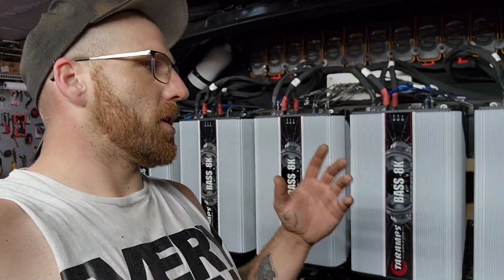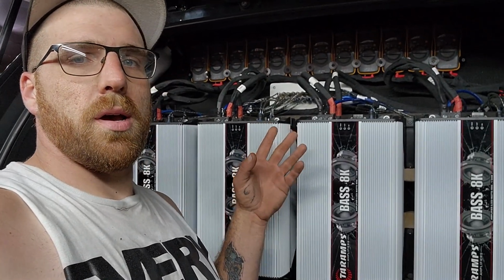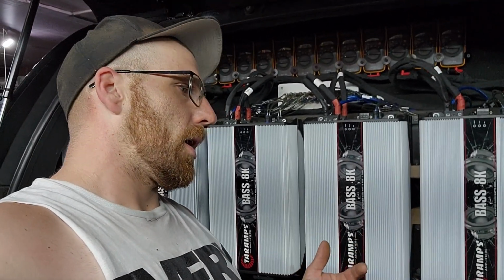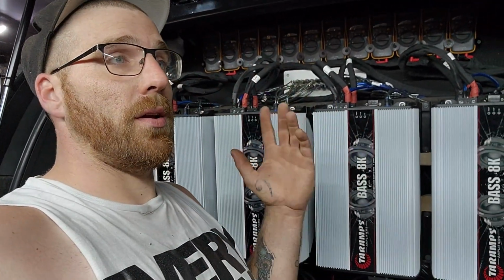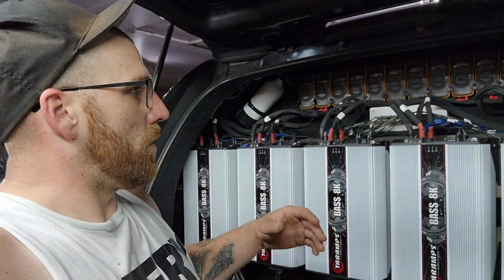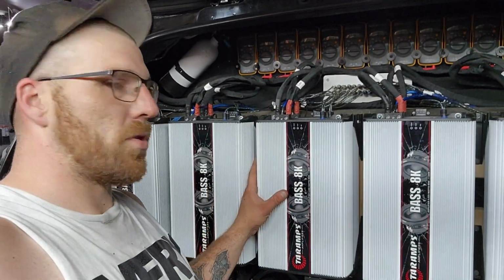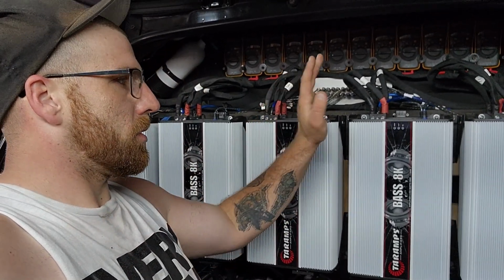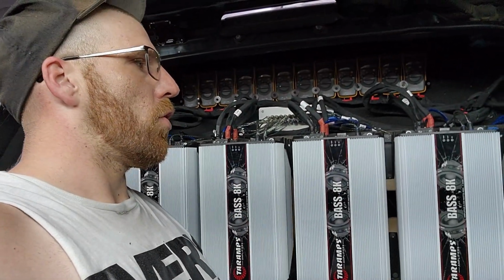I doubt I will, just because I just went out and tested it, and obviously with the brand new sub, I definitely shouldn't have turned it up as much as I did, but I turned it up, and something was smelling absolutely horrible, like it was on straight fire. So I checked everything, nothing at all seems bad. So I'm hoping it's just the new sub with all that power obviously being dumped to it. I'm gonna still kind of look into that, but that's what I'm hoping. But 70 volts all the way out, like I said, about 45 where I normally demo.